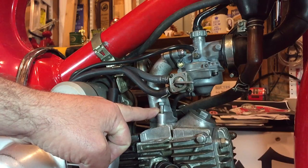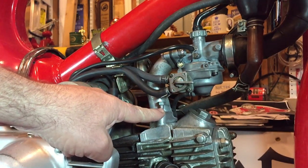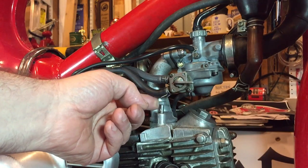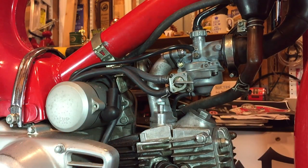So it looks like it may be this manifold here. You can see I've already started to lift the bolts out of the manifold. What I did was I soaked those screws in penetrating oil for quite a number of days — actually it's been over a week — just to make sure that as I took those out I didn't bust any threads, and they came out pretty easily.